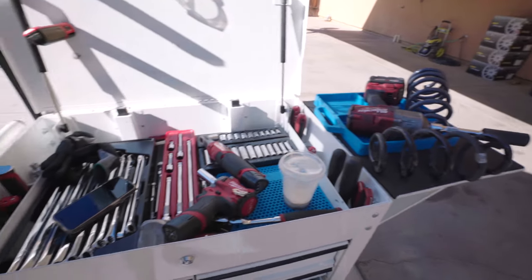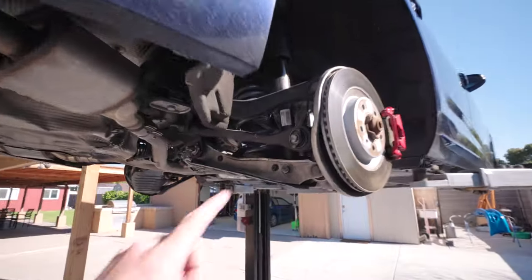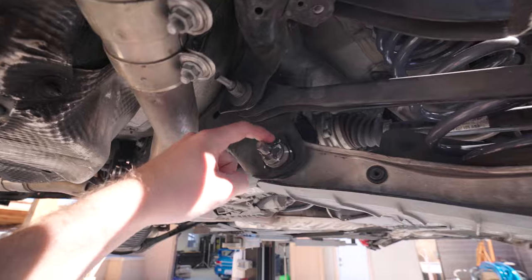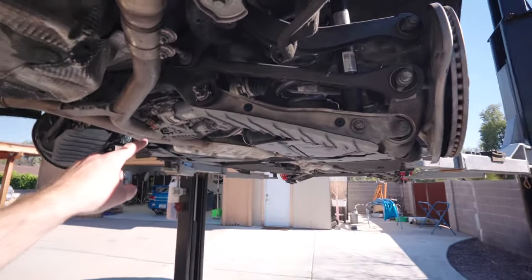You know what this means. I just finished up the passenger side. It went well. You can see the gray 034 spring right there. What I did, take out this plastic clip, took out the lower shock bolt, and then I took out this bolt right here. Then I used two pole jacks right here, which could be jacks on the ground if you're doing this on the ground.